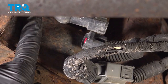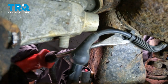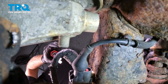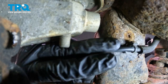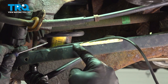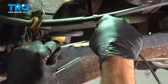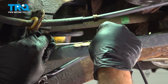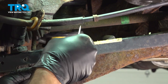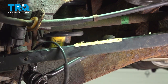On the top here, there's a plastic retainer clip. I'm going to use a trim tool to release this plastic clip and pull that wire back and out. On the top of the rear lower control arm, our wire is held in by a little metal retainer clip. We're going to use our pocket screwdriver to open that up and pull that wire out, then continue to pull it out and around.